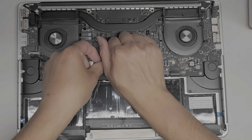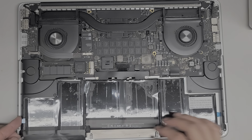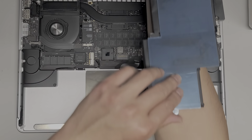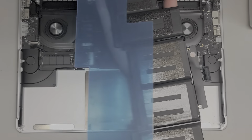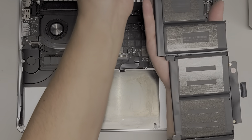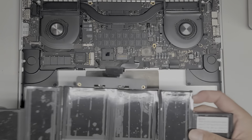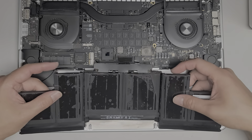Let's pull the battery connector back out — just like this. Then we'll lift this battery out using the little blue tab. Peel this off just like this — it should come off easily. If it doesn't come off easily, they might have put this plastic on wrong, and you'll probably want to get a replacement battery because it's going to be almost impossible to separate.